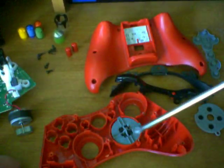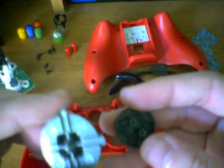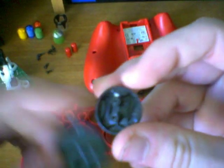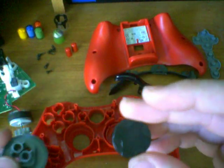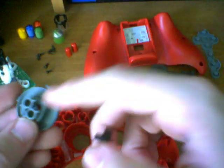We're going to simply unscrew the screws one by one. One screw comes out, then we finish off the other one, and that screw comes out as well. Now that both screws are out, the two parts of the D-pad will separate. Depending on what D-pad you have, it might have attachments on the side — all those attachments do is clip into these little side parts. The two main pegs go into the hole, and the other two side parts clip in. Just give it a tug and they should come apart very easily. This can be useful if you want to switch out the color of your D-pad — for example, if you have a gray one and want to switch it out for a black one, all you have to do is take out this part.